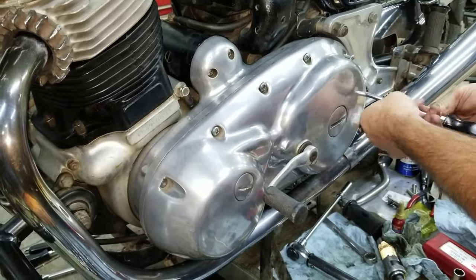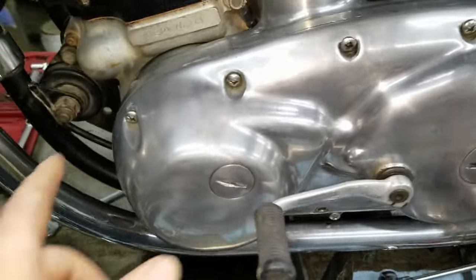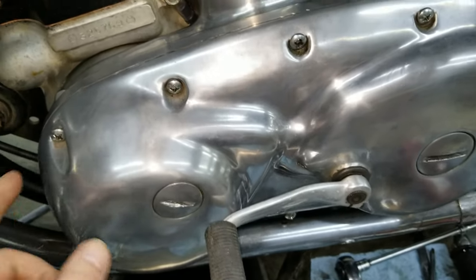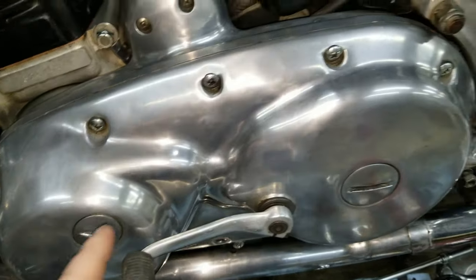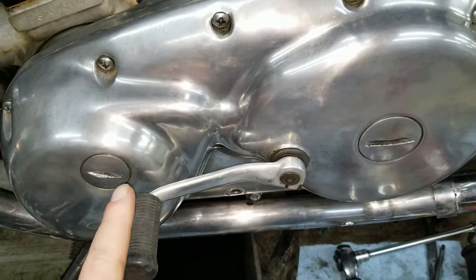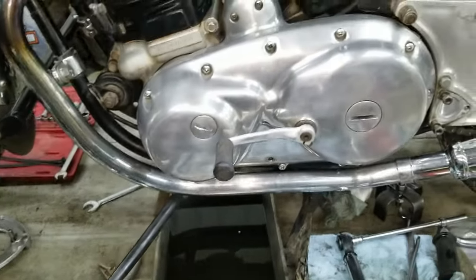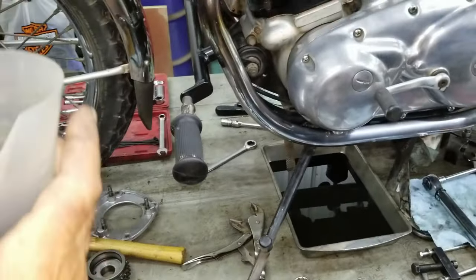We've got the screws all tightened down. It's about 60 to 80 inch-pounds. We end up using the screwdriver and just go until we know that it's tight. And now we're going to open this up and fill it with oil, which we end up putting in Mobil 1 20W-50. It was like 300 or 500 cc? 300.